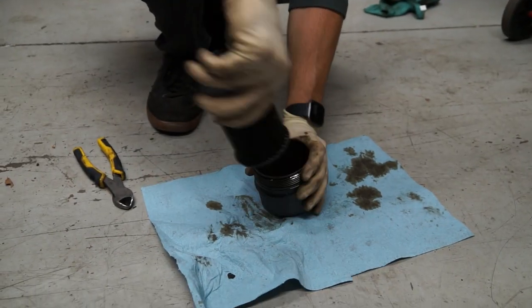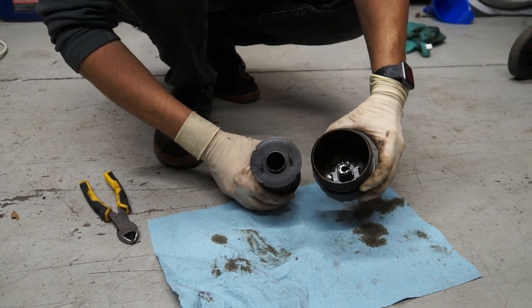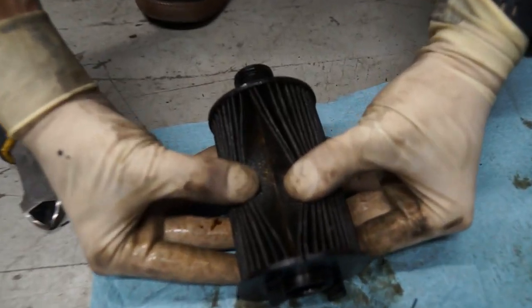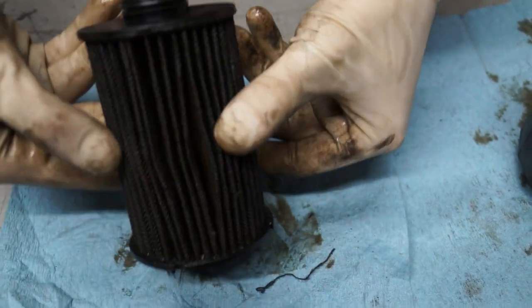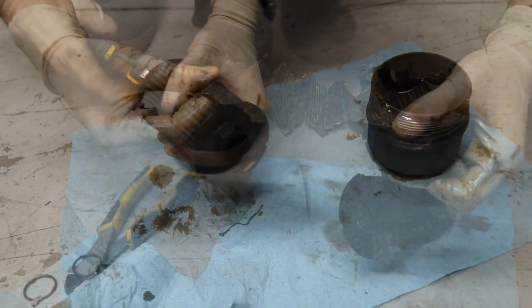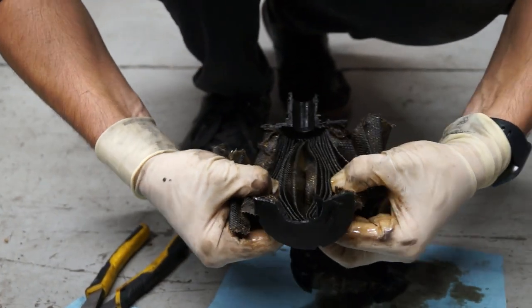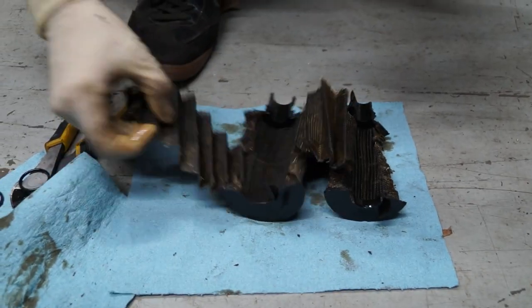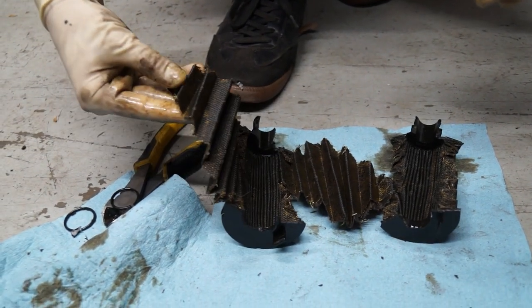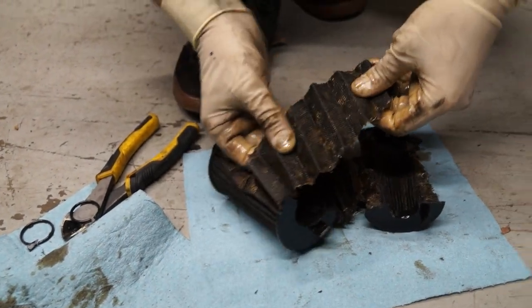I don't know how this comes out. It actually has locating pins — so don't try to spin it like I did. That doesn't look too hot. You can see kind of a coppery substance there. I'm gonna cut into it and see if we can find anything — see if there's anything shiny coming back, because the whole thing is shiny. Anyways, this is where the Blackstone report comes in. Your filter might catch some metal particles, but whatever we just pulled out of the oil pan, oil-wise, they're gonna run an analysis on it and give us feedback.